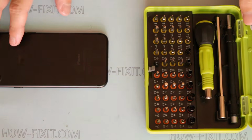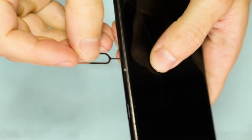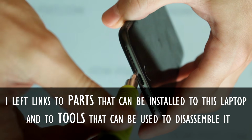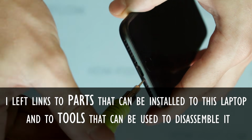Hello everyone, today I show you how to disassemble iPhone 7 and replace the motherboard. Remove the SIM card tray. Unscrew two screws on the bottom of iPhone. In the description of this video I left links to necessary tools for iPhone 7.